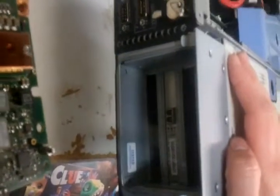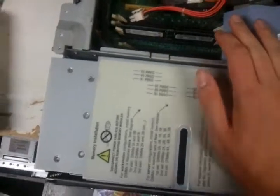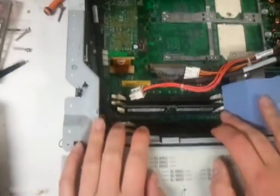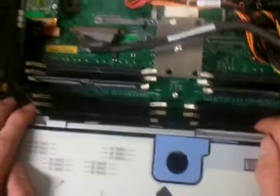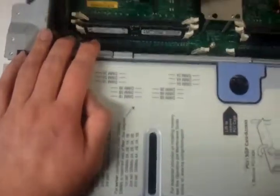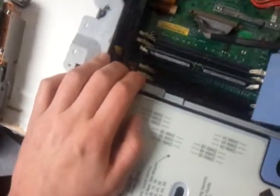The keys came strapped to the back — you get four. I put a fiber card in there just for giggles. You've got four PCI-X slots; the top one is the fastest with one-gig throughput and all the others have 500. This is a DDR1 system — I think you can equip it to around 24 gigs if you can find the RAM. It's registered memory. I currently have 8 gigs in there with 2GB modules. It's not terribly expensive, but finding massive capacity for an old system like this can be a pain.